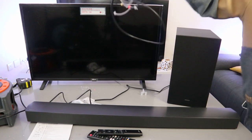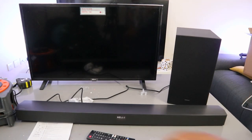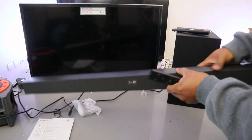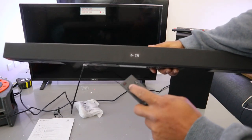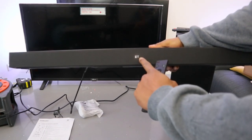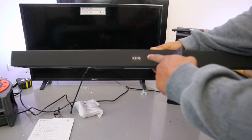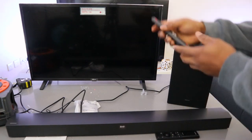This is the optical cable. We want to connect via Bluetooth now. Switch the soundbar on — it will show 'hello' and currently shows digital audio in. Use the input button to select BT, then select pair. Once you select BT and then pair, it will enter Bluetooth pairing mode. Now we need to switch the TV on.